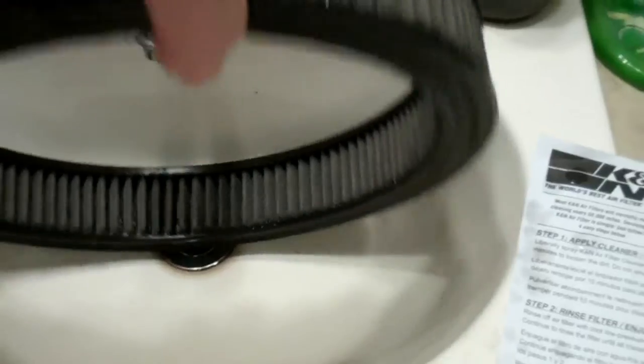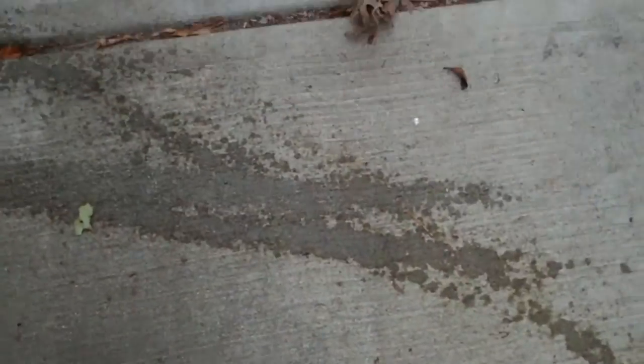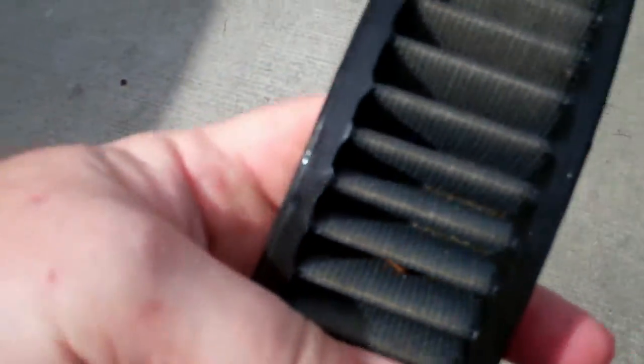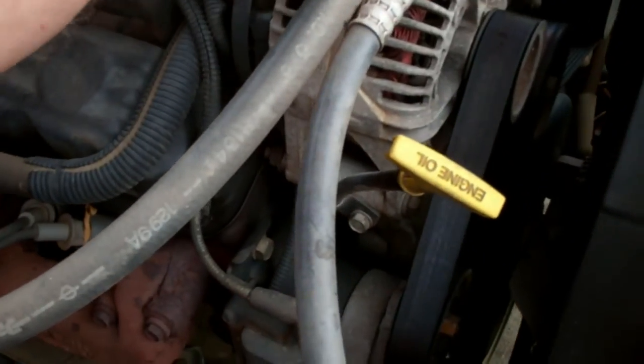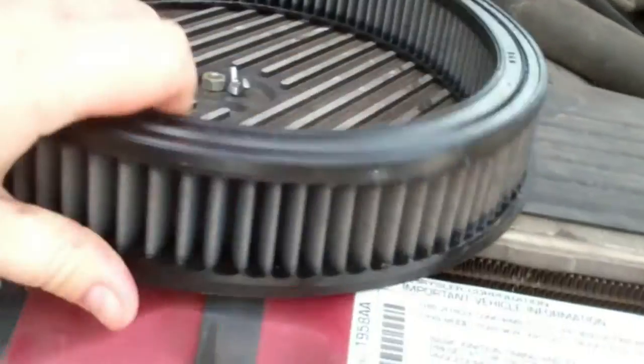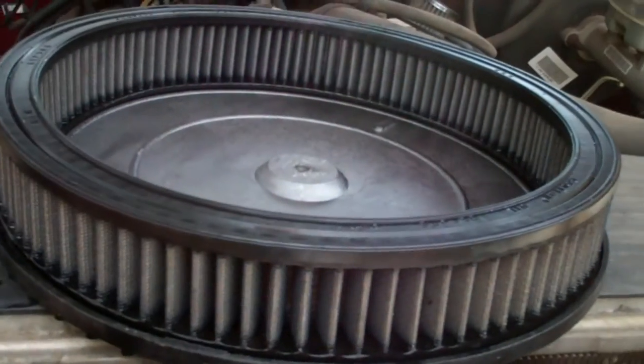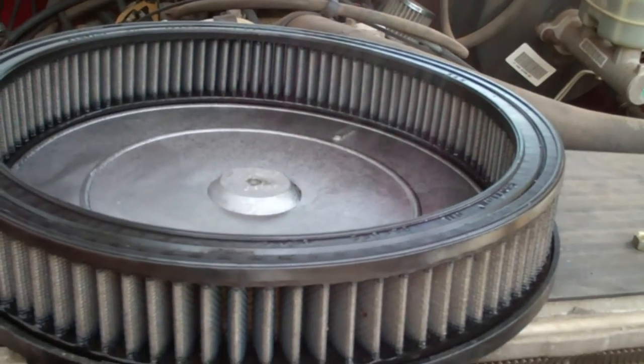We'll just go ahead and take it back outside and shake it. You get it in the sunlight and it's got a little bit of cleanliness back to it. Now it says let it air dry naturally. Actually, on second thought, I'll let it air because I've got to put oil on it — I almost forgot about that. I'll put it on the underside of the lid and let it dry. I'm going to clean up my mess while I'm waiting on the filter to dry so I have no problems with the wife. Got the filter in the sun. That'll help dry it quicker, and then we'll be ready to put the oil on.